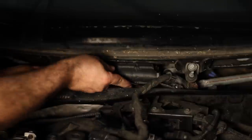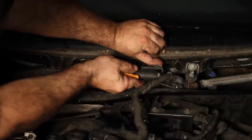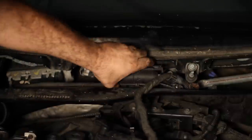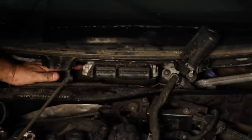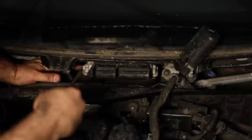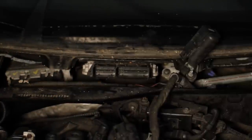I'm going to do the same thing on the other side — grab it, push, and it comes out pretty easy as long as you know the tricks. And that's the ECU. Now this ECU has a metal locking tab right here — it's only on one side. You have to bend it back. So I'm bending it back, and now the ECU should be released.